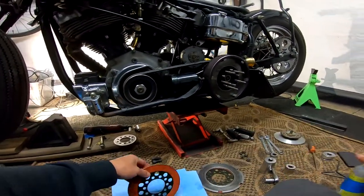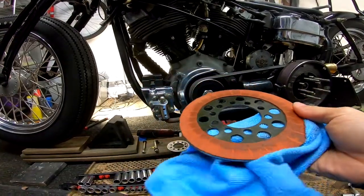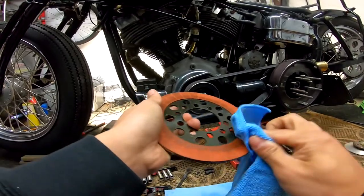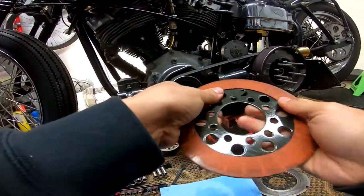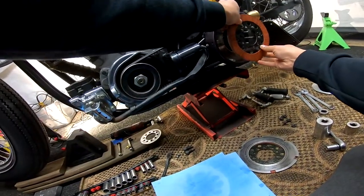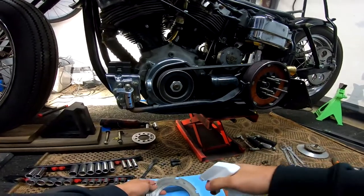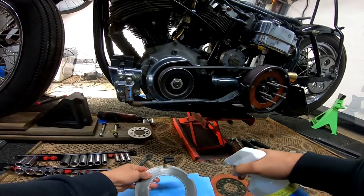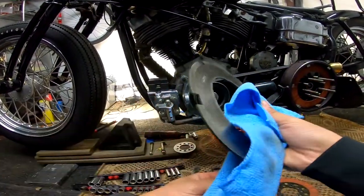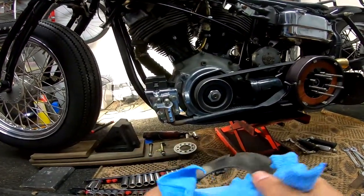Towards the outside you'll see it gets a little dustier. Remember in the clutch: always sandwich the steels. That's rule number one — sandwich the steels, steels are always in the middle. Don't ever leave any steel plates on the outside.